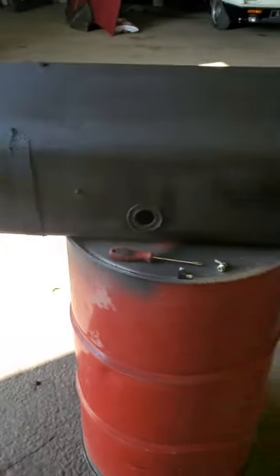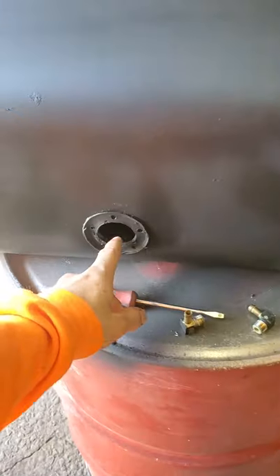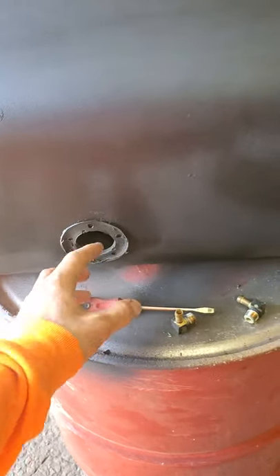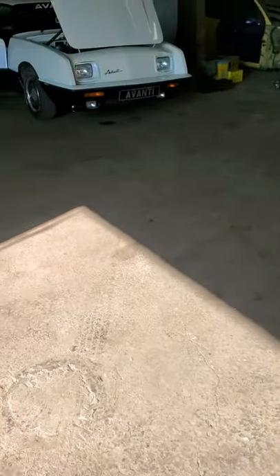This is the tank that came out of it. You're going to have multiple pipe fittings with hoses attached to them. This is where your level sending unit is, which tells you your fuel level. There is a fitting at the bottom of the tank — this is the bottom — and you're going to have to jack up the car and remove it, as it will not allow you to remove the tank otherwise.